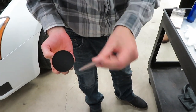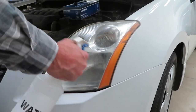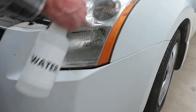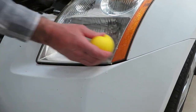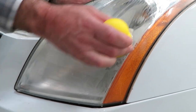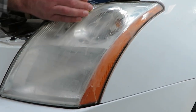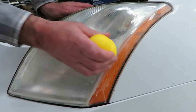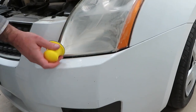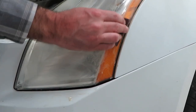Moving to the 2000 grit sandpaper — it's the red disc. It's going to do the heavy lifting on the abrasion side and get a lot of the imperfections out of the headlights. We're going to wet really well, and wet our sandpaper as well. What we want to see is the sanding starting to bring off some of the yellow. It's going to look foggy as we start to sand — that's a good thing because we're getting into the polycarbonate. We'll start to see this go from a white hazy yellow into a nice clean white look. You can take these discs off, fold them up, and get onto the edges cleanly without dipping into your paint.